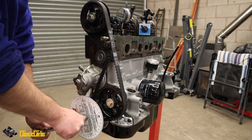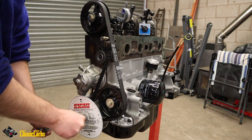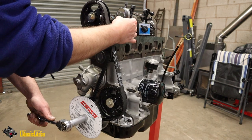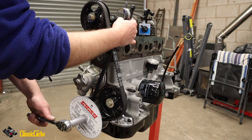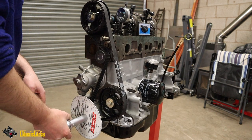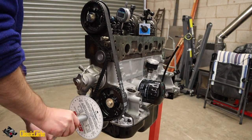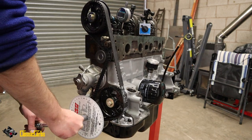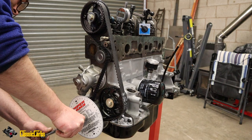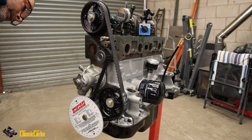Okay, let's turn engine slowly because we've moved the cam tooth. Right, so I think we can zero that now. No, not off. Yeah, that's it, zero, okay. So what we said we were gonna do, so now exhaust is opening now. All right, now we're getting rid of our waste gases. We're at top dead center now. And the TDC marker's bloody moved.